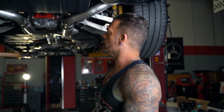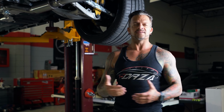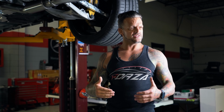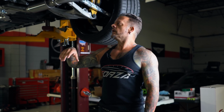So on the Trackhawk, it has this suitcase style muffler. So it has mufflers in the back, but then in the middle of the truck has this suitcase style, kind of like the newer ZL1 Camaros. It's really restrictive, even with the headers and stuff. It doesn't really sound all that good, and it is robbing power. So we recommend a Catback.